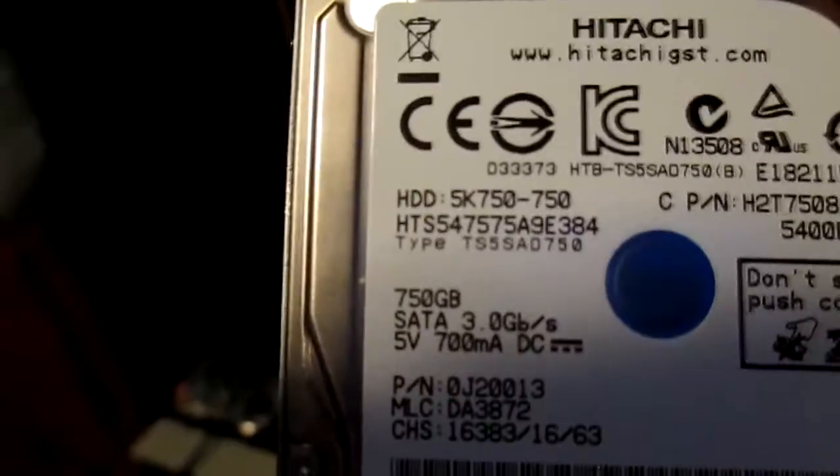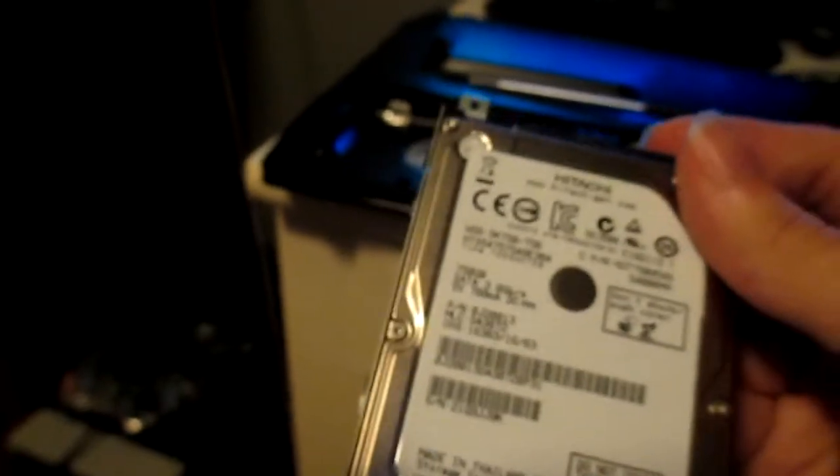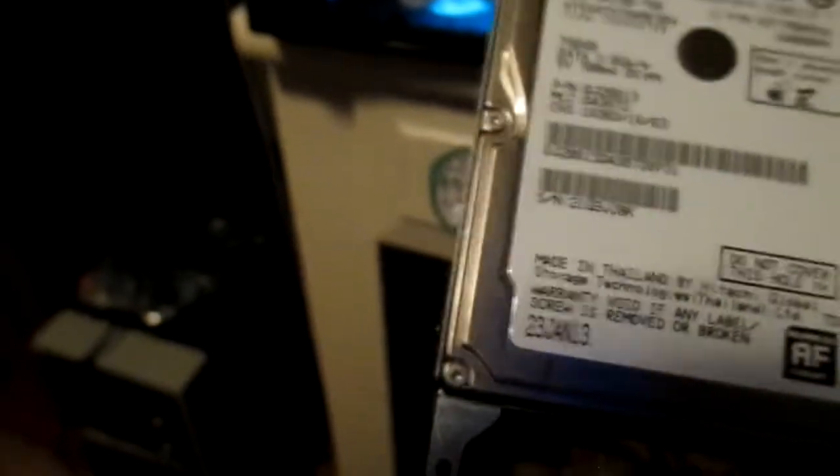That's the fourth screw. Now you have a little tab here that pops up. All you do is take it, hold it, and slide outwards — then just pull up and the drive comes out. This is the Hitachi 750GB, 3GB/s drive. For the money — this was a $449 laptop — it wasn't a bad drive. I did get a lot of use out of mine; I used it for frapsing and everything else, so that's probably what killed it. Let's get to removing the drive from the caddy. On the caddy there are two screws on both sides — you just remove those and the drive will come out.